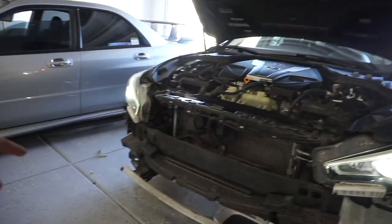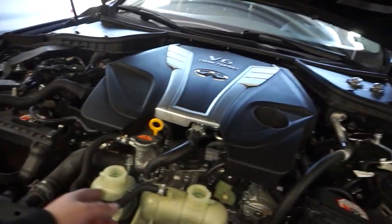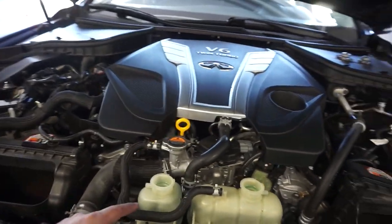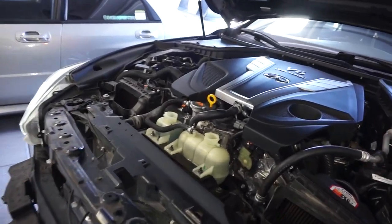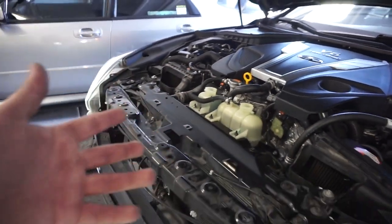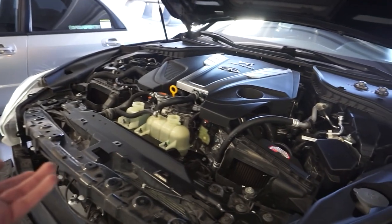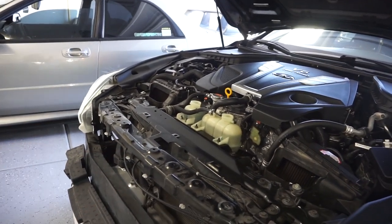We got everything on — crash beam's on, the foam reinforcement is on. We just bled the cooling system. What I usually do to bleed cooling systems is take both caps off, fill them up all the way to the top, then turn on the car and keep filling them up as needed. Make sure the car warms up all the way to operating temp, and I let it go all the way to operating temp and probably even 15 minutes after that, just so all the bubbles bleed out. It is going to be dripping — that's just the way it is if you do it this way. I know the proper way is to use a pressure bleeder but I don't have one. The car warmed up fine, didn't overheat at all, fans kicked on, thermostat ran through. No leaks on the heat exchanger.